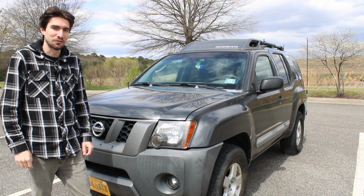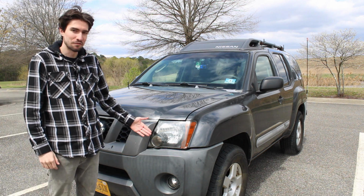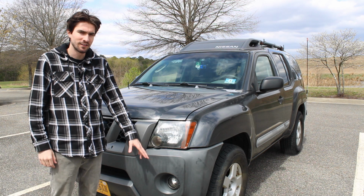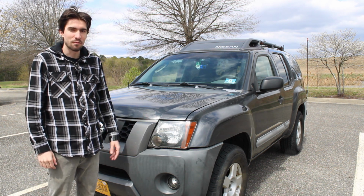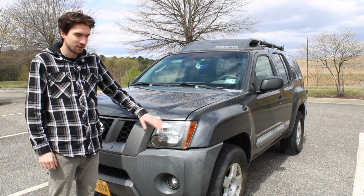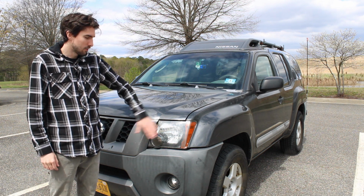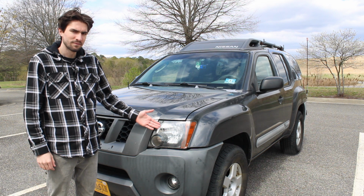Well, there you go. The Turtle Wax Headlight Restoration Kit is a success. It's much clearer. I also applied it to my fog lights, and it was a simple 4-step process. Just apply the compound, sand it down with a little water, reapply the compound, add the acrylic coating, and voila.